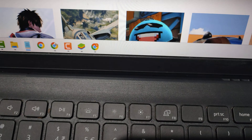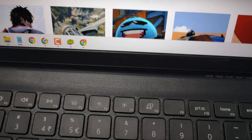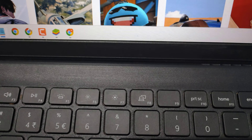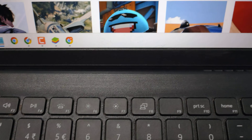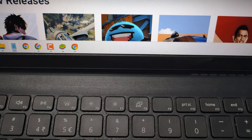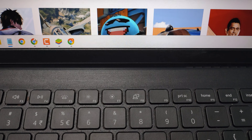Plug out and plug in your charger, and after that try a second time. Press the refresh key and the power button together again for 10 to 15 seconds. Note: the device I'm showing is a Dell, not a Chromebook, but on your Chromebook you will see the refresh key in the first row of keys.